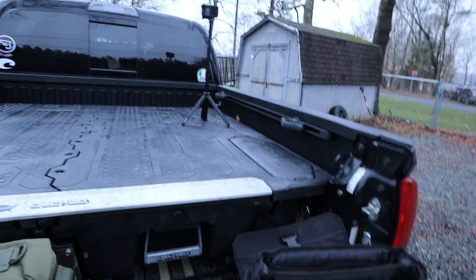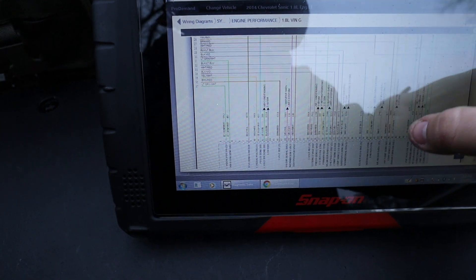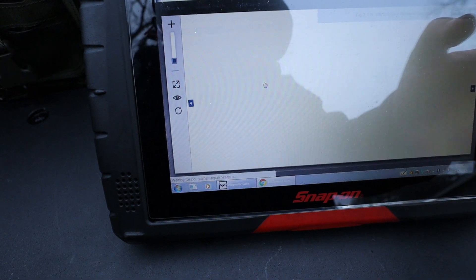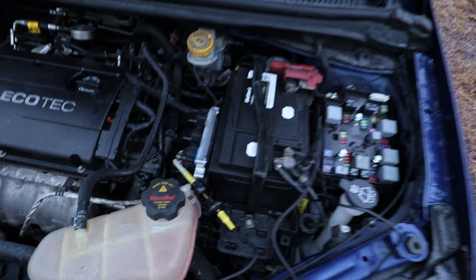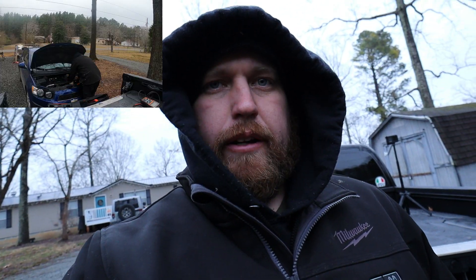I went over the schematic off of ProDemand. For this PCM, you've only got one keep alive power, and that goes off of the ECU fuse. It's the only one — it goes straight down. I verified the pin number and wire color, and I'm currently probed in on that one. On a PCM I typically don't like to back probe because the pins are so small you'll run into issues. So I'm piercing on that and watching my data using the e-scope.